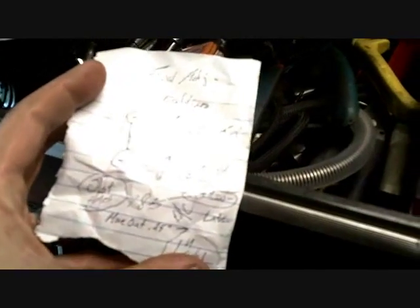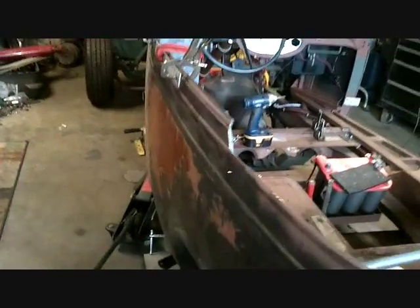I'm drinking vanilla Coke and eating crackers and measuring changes for the door and the B-pillar plate again — should be the third time, but you got to do it. I moved the body lines up a little because they don't fit exactly in the notches. It's clamped to the frame, sitting on the body on that shelf. I moved those holes in, made it the width of the door, kicked the bottom out an inch and a half. Now I just got to move it all inward because all those adjustments screwed with the width. It looks really fat though — gave it a hell of a curve. But right here there's like a three-quarters-of-an-inch gap, here there's an inch, here there's three quarters. I'm pushing out a curve so this ends up with a big gap, so that's got to go.